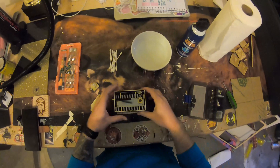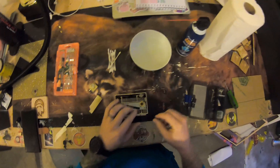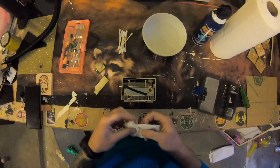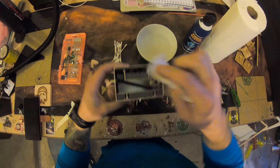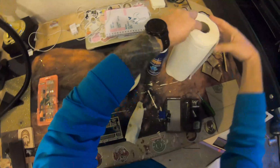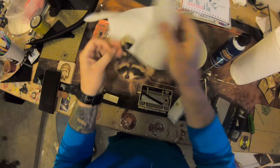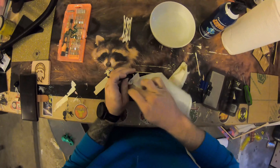You can unscrew them. Check the lens and make sure that it looks okay, because sometimes you'll get little dots in there. I have another video for that if you want to watch that. Now I like to use a really damp cloth to wipe off all the surfaces — just kind of get all the dust that's gone up in there. Then you want a dry towel to wipe these off and get any moisture that you might have still on any of these items: one to prevent corrosion, but two, you're dealing with electronics, so you don't want anything to sit on there, especially when you provide power back to it.